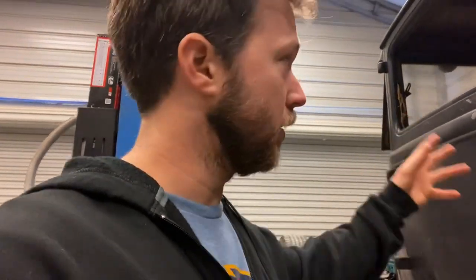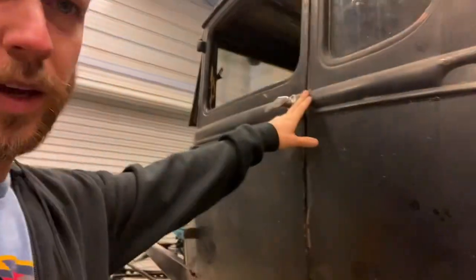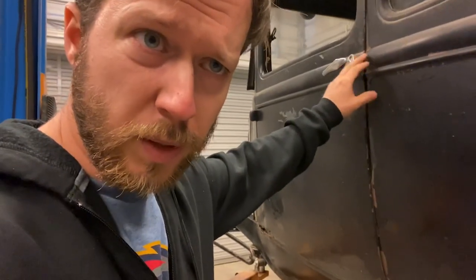I hadn't taken enough out of the front on that pedestal, the very front piece that I made where I cut out on the Model A. The bottom dips down and the frame dips up, so they don't go together. It makes a little spot where you can put your hand in there, and it just doesn't look right. So I cut that out and welded the other piece in. The doors were probably sagging this far.